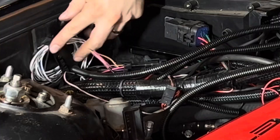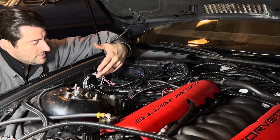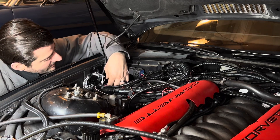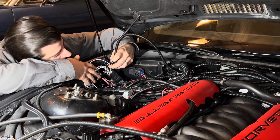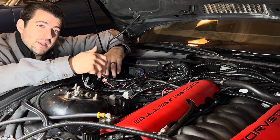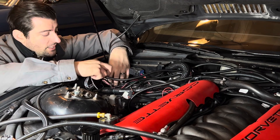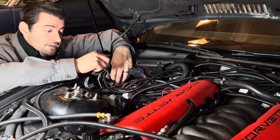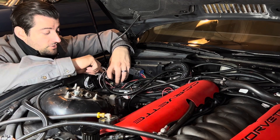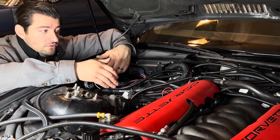They give you these wires which I have tied up for now until I know exactly which ones I'll use. I took one wire from there — it has a pinout — green and gray, which is what I'm using for the boost controller. I set it up in the Terminator X software first before coming out here to wire it in, because I needed to assign the output and make sure the right output matches up. What's great about Holley is the wires are labeled if you look closely on a newer Holley, so the Terminator X software shows the wire designation so you can match it to the ECU output.